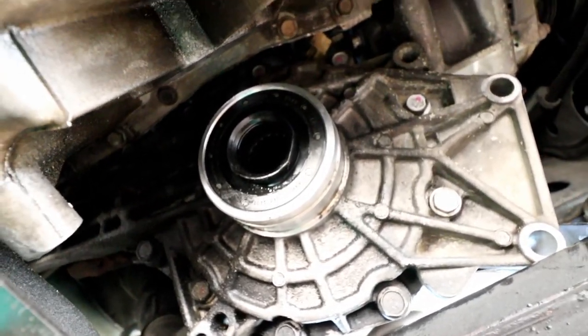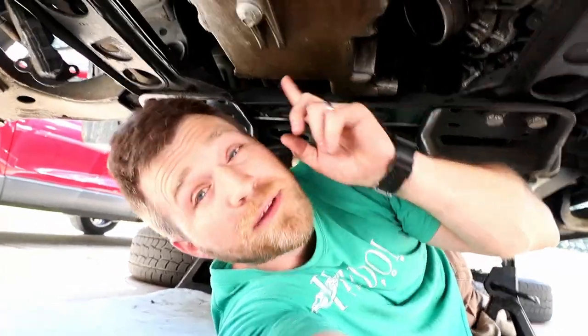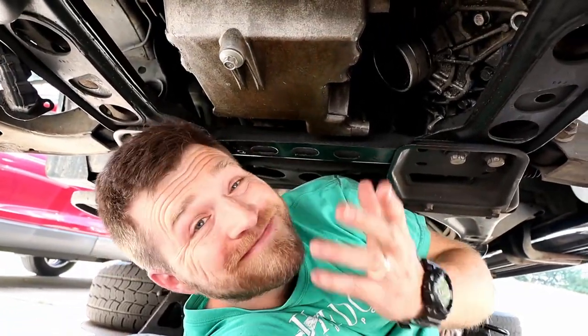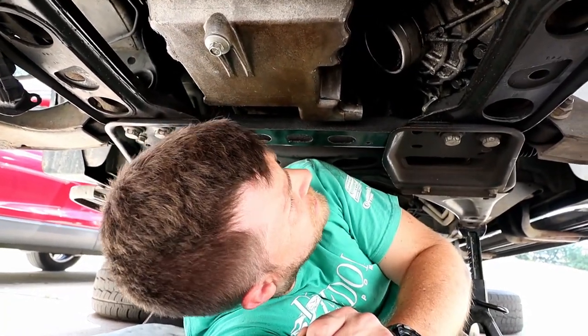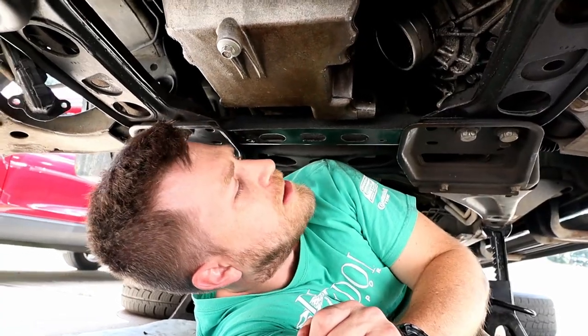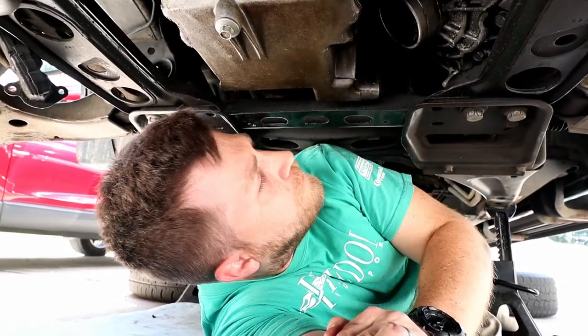I am super pumped about that. It was kind of a medium amount of work to get to this point. I think the hardest parts were that lower bolt, also removing the half shafts, and then that intermediate shaft that runs through the oil pan. But now it should be pretty straightforward. Get my seal pullers, pop that new seal back in. I'm just hoping that I've got enough of an angle to get my seal installer hammer tool on that face enough to where I can hammer it.